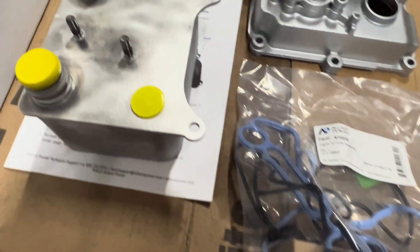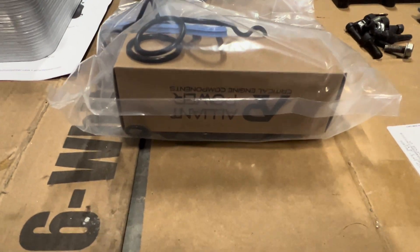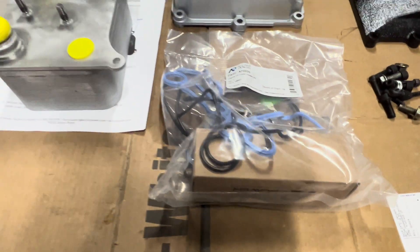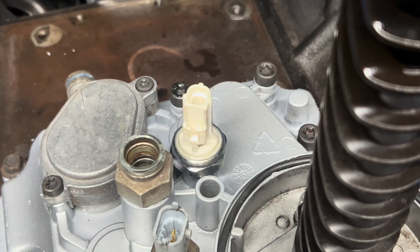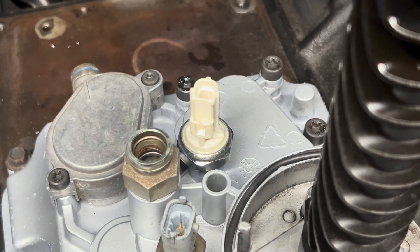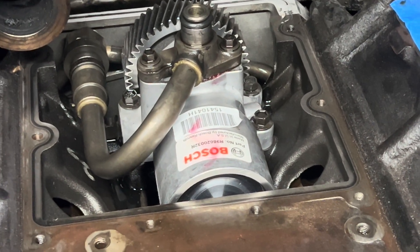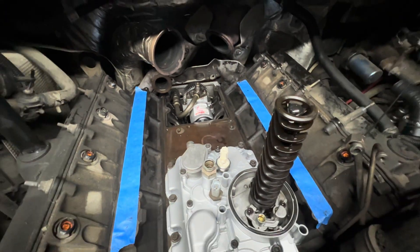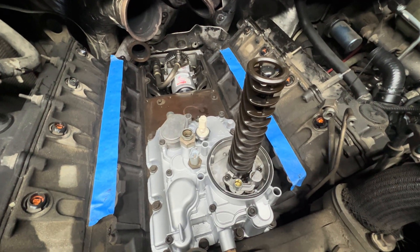We're going to be putting it back in the truck. Here's the new cooler — all the gaskets are super nice, high quality, the screen is super nice. We got the oil cooler and the pump in there now. I got a new engine oil pressure sensor too — I always like to put a new one in because they break and spew oil everywhere. If you've ever had one break, it's a mess. We got the pump all in there nice and tidy. Now we just have to do the high-pressure oil pump cover, and then once we get the EGR cooler and weld up the intake manifold, we'll throw that on and put the whole truck back together.